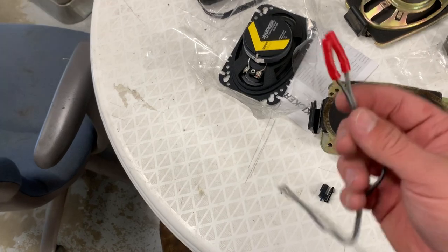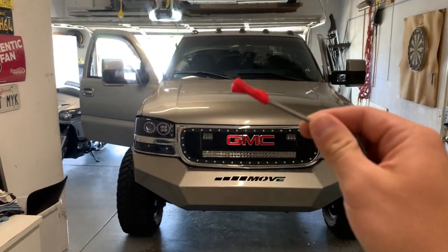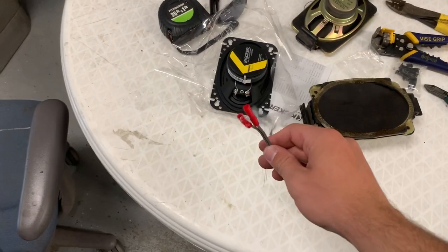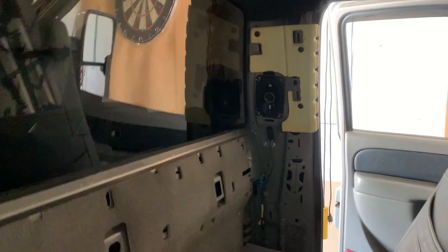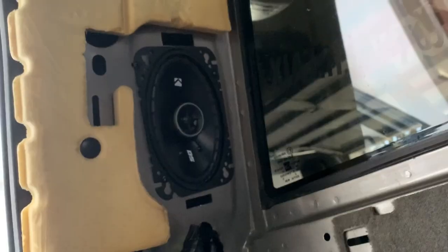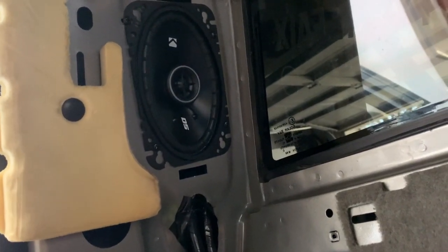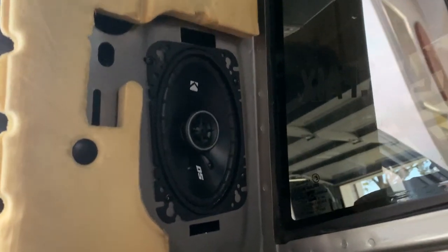Positive to positive, negative to negative — over on the truck in the door get that wired up, then literally just plug those in, mount those, and you're good to go. Now we've got the new speakers installed. Put them up there, mark with a pen the holes where you're going to drill because you will have to drill some holes. Drill out your holes, use the screws that the kit came with, and screw them into place once you've got them wired up.